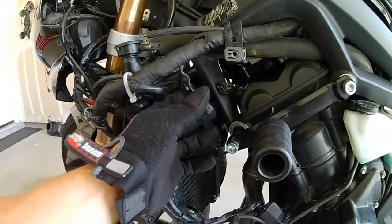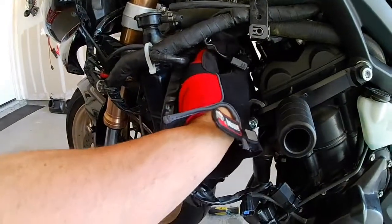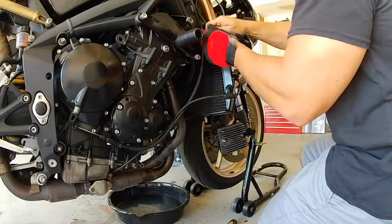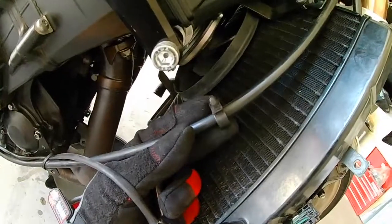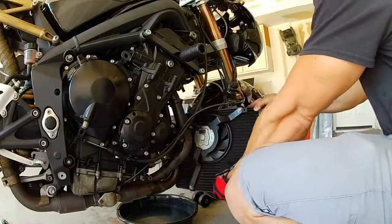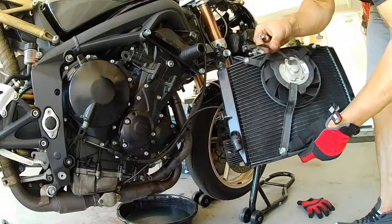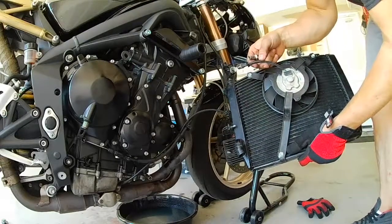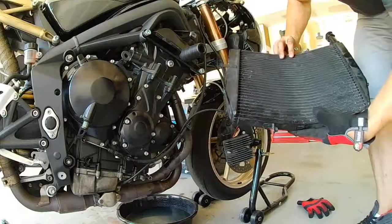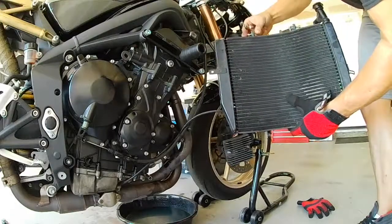On the left-hand side of the bike, there's the main wiring harness — you'll have to disconnect this connector right here, which is the power lead that goes to the radiator fan. There was also this clip that had to be removed; you just squeeze the tip and pull it through the other side. I'm going to put some tape on these and mark where they go so I don't have any problem reconnecting the wiring harness later. The radiator looks like it's in really good shape, so that's one less thing to replace.